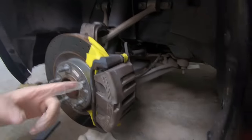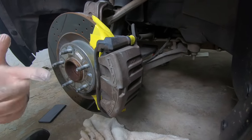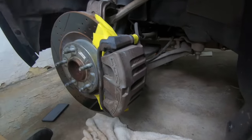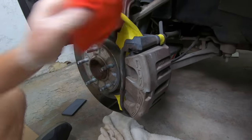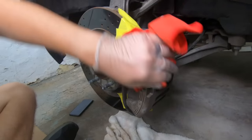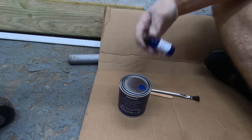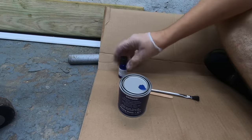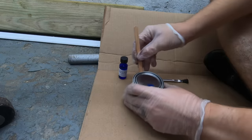Once it's cleaned up, I'm going to do everything in the mirror — this side, then that side. Each side needs about three coats of paint with ten minutes between each coat to dry. The plan is to alternate sides while each coat dries. We've sprayed it down a couple times, now we're going to clean it really well with a cloth and get to painting. Here's the paint, and this is the reactor that makes the paint dry and stick on really well.